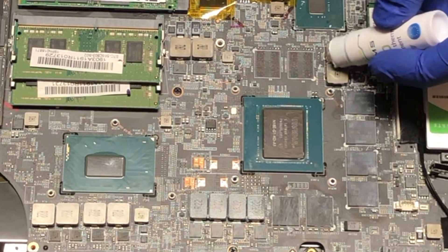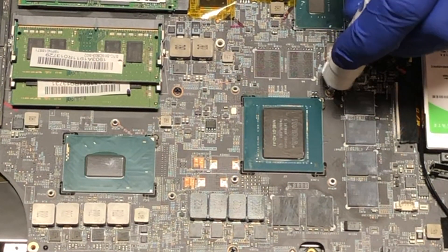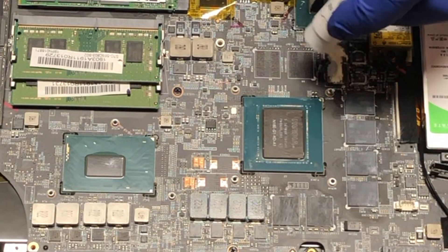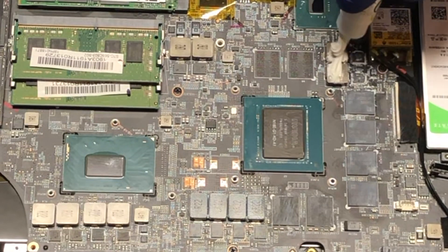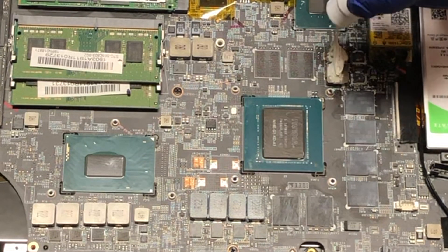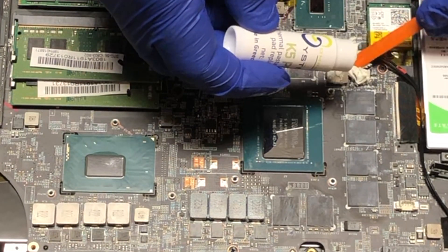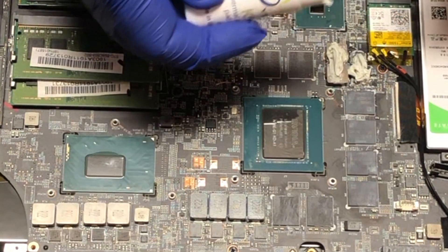I will now add the K5 Pro to the board. Be warned, it may look like a lot but this is normal. This is not thermal grease. When I was adding the product I kind of got upset because I spent a lot of time cleaning the area. If you attempt this, it is very difficult to apply. After a couple of applications it will become easy. Just add a modest amount and don't look back. Remember that thermal pads are different sizes and the paste will spread over the area as it is squished. Again, this is non-conductive but it is messy.